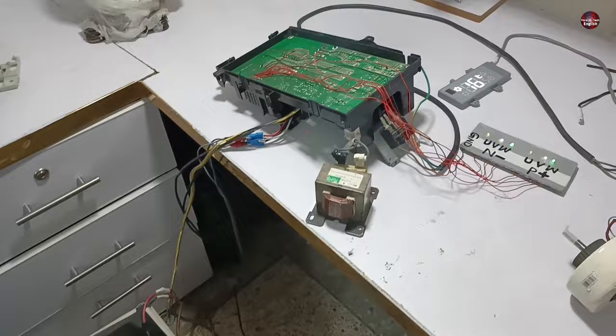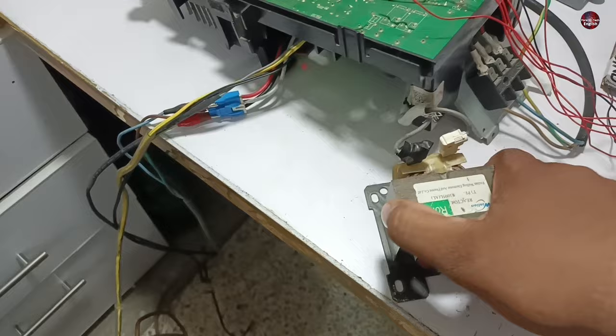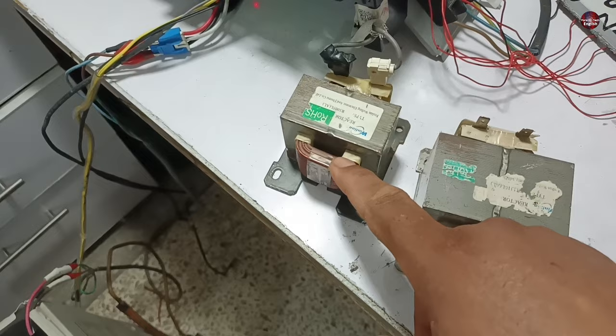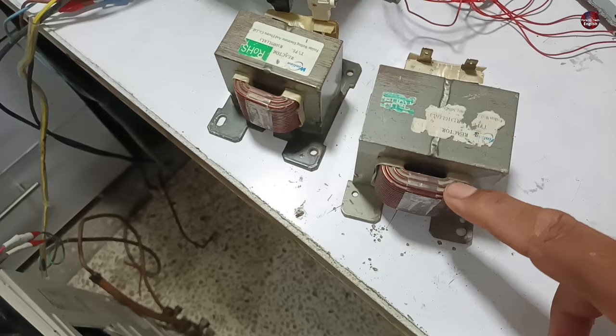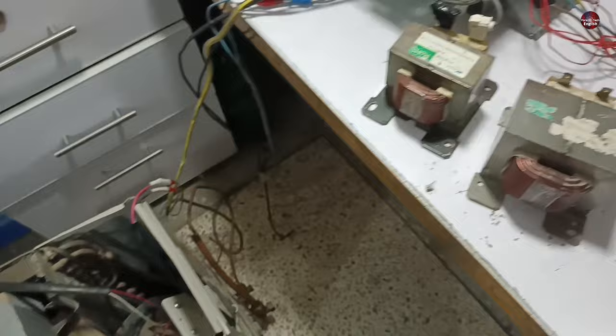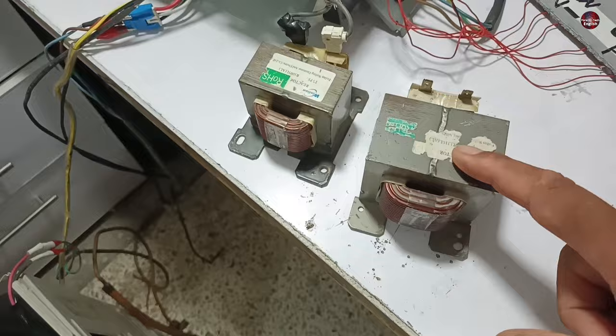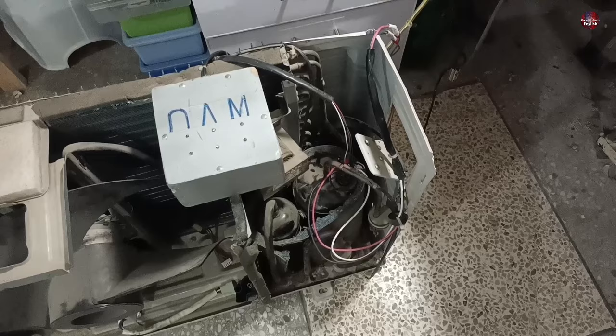Here is a small tip: whenever you are checking a bigger compressor than the rated capacity of the motherboard, use a bigger reactor or inductor. This reactor handles 8 amperes, while this other one is a 12-ampere inductor — use the larger one, as it stores more current. The bigger reactor has 4 turns versus 3 turns on the smaller one. If you want to use a bigger compressor permanently, then definitely use a bigger inductor.